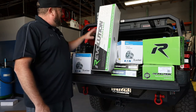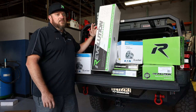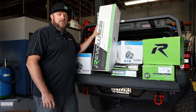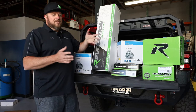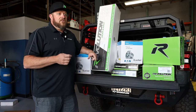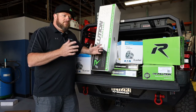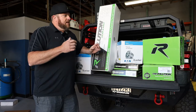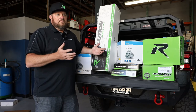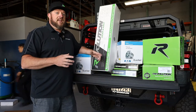Eaton jumped on board. We have our chromoly axle kits for the rear — we have these for the new JL Rubicon, JL non-Rubicon, JT Rubicon, and this is a prototype for the JT Sport. A little bit different lengths. One cool thing about what Jeep has done — they're listening to the aftermarket world. The old TJ and JK had a smaller set-10 bearing, typical Dana 44 size. They've upgraded these JL Rubicons and JTs to all the larger set-80 bearings, so it's basically a Dana 60 housing — we're seeing a lot less bent flanges, which was a big problem on the JK.